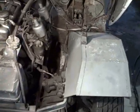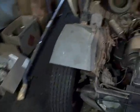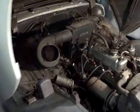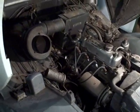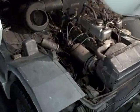It's almost guaranteed that the one in the car is going to be leaking the minute we fill it up with hydraulic fluid. What needs to be done is this whole metal tray and pedal box - it's just a series of 10 bolts - lifts out and takes the pedals with it. You disconnect the lines in the back of the cylinder, put the new cylinder in, hook up the pedals, lubricate the push rods, bolt the whole thing back in, and bleed the system. This is the brain for the clutch and brakes on these cars, and almost every old British car that's been sitting for a while will need one of these. It's a project well within the reach of any hobbyist.